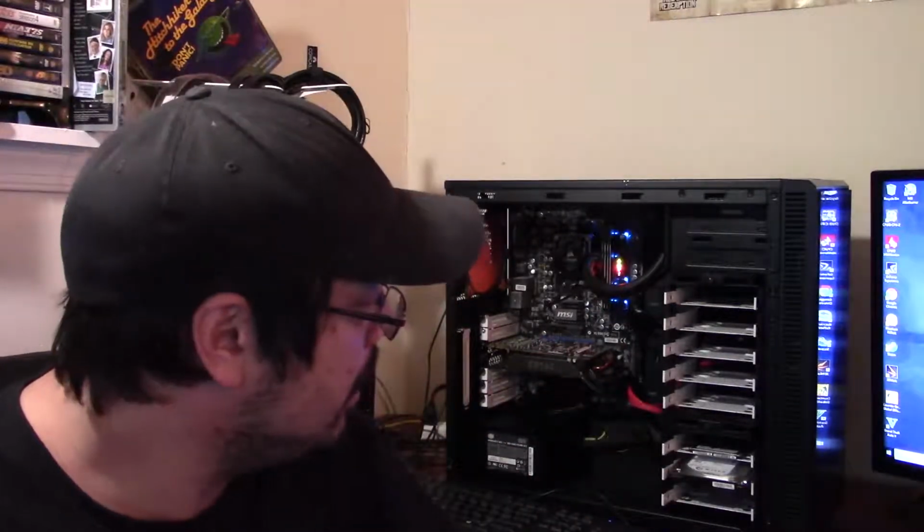Because when you start overclocking, for some reason it skips right over the 667 and starts overclocking from 800 megahertz, which causes memory issues because that memory is not really overclockable. With this setup, I was able to overclock it to 3.2 gigahertz, however I was having memory problems. If I can get better memory, I can easily go over 3.2.